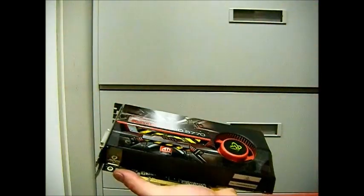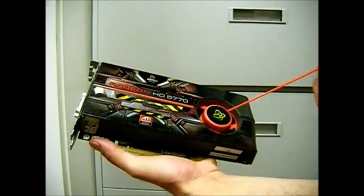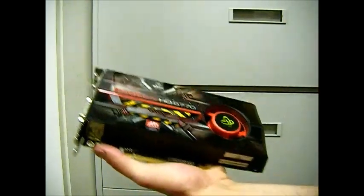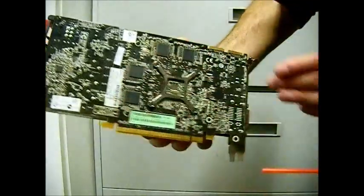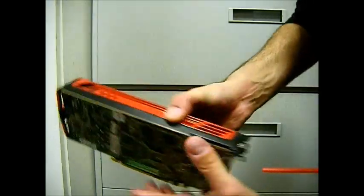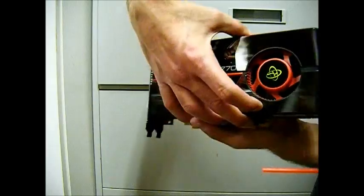Where the fan hole is right here — you just want to spray, make sure you get everything out of that location. Then there will be some vents on this side — you want to get the back area. There is a vent on this side, you want to get the back area and everything. On the top there are more vents, so you just want to spray through all the vents and make sure you get at least the majority of the dust out. That should be sufficient for the video card.